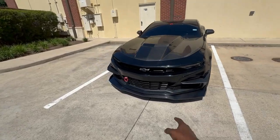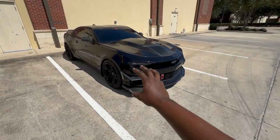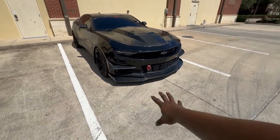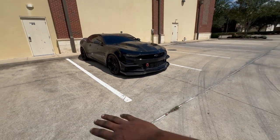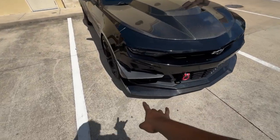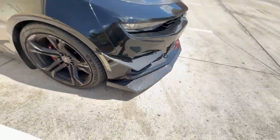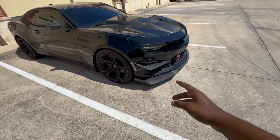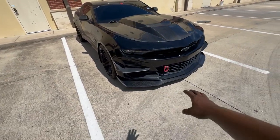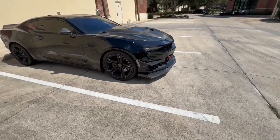I'll tell you a couple things to look out for if you have a 1LE. Most of these things are 1LE-specific. If you have a regular 2SS or 1SS and you don't already have a front splitter, it's literally just gonna bolt up — simple as that. Now if you do get the carbon fiber or forged carbon fiber variants of the splitter, you're gonna have to use double-sided sticky tape or JB Weld to get your winglets put on, because there are no pre-drilled holes or screws like on the plastic variant.